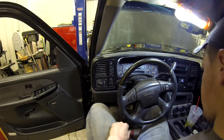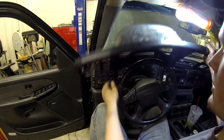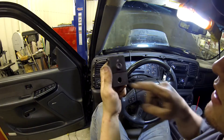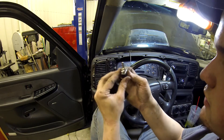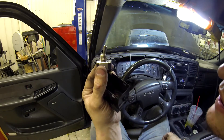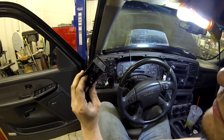Let's get on with removing the dash since that's going to be where I'm installing my switch. I'm going to be installing my switch right there in this drilled hole and running the wires off the back of it. I have my switch in hand — I'm going to take off the backing nut and the face plate. With the backing nut you can set the height you want; I like mine just about there so the switch doesn't look all goofy. Then go ahead and insert the switch — you'll have plenty of room to install it there.